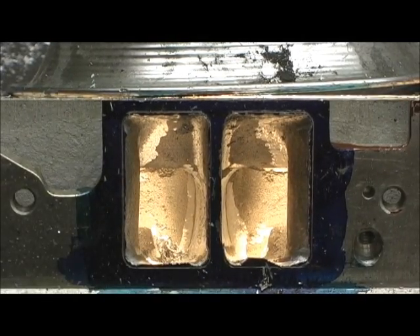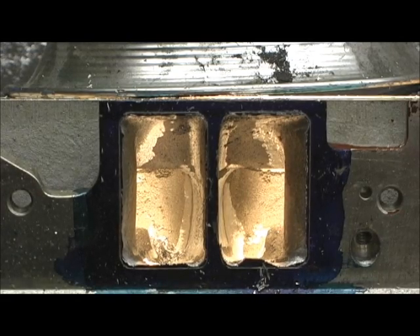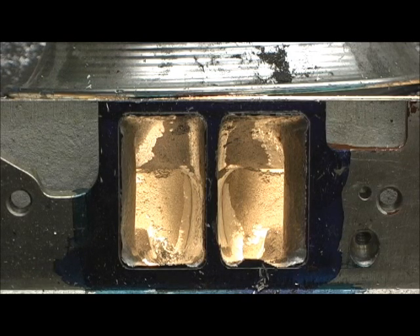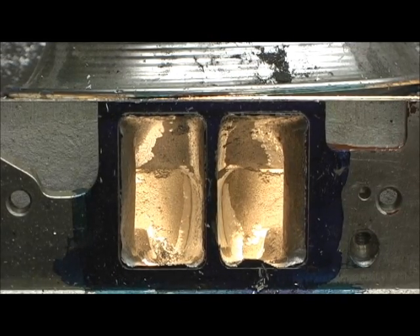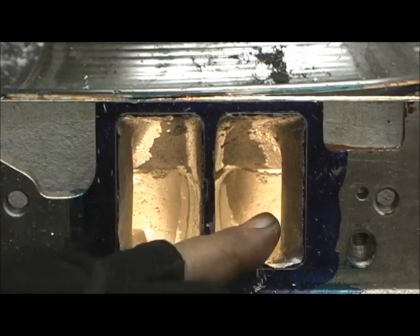The amazing thing is that wall hasn't been touched on the floor. But with all this work and all this cutting, these are 190s and they're going to end up around 210, maybe 212, 213 — somewhere in that range. So you ask yourself, why would you buy a 190? Why not just buy the 210? I can promise you the 210 version compared to the stock 210 — there's no comparison. We end up with a 210cc head flowing in the 280-290 CFM range, maybe even 300. Whereas the stock 210 out of the box does maybe 250. There's just no comparison, because it's not about volume — it's about shape.